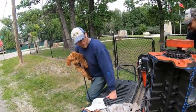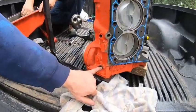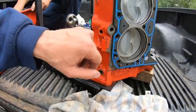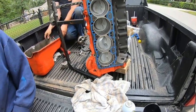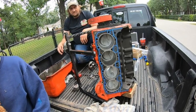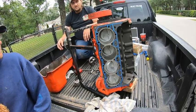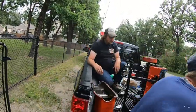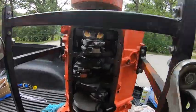I've never seen two on an outer. I guess it's an early Chevy. I've never noticed, but here's your hole for your ball for the clutch pivot there, and I guess there's one here too. I never noticed that before. I've never seen another Chevy like it, but maybe it's an earlier one. It's strange that it's still standard bore, and it's all in spec. I don't think it had many miles on it. I checked the cylinders, and all within half a thousandth of each other, they're good.